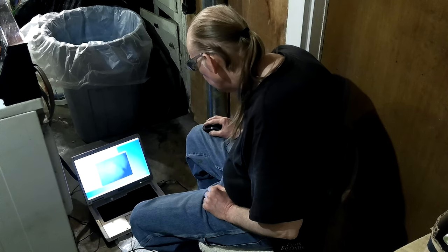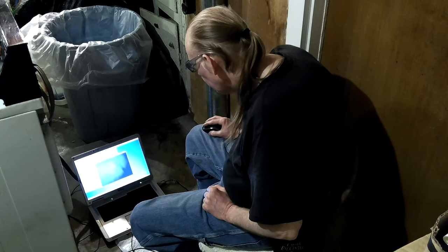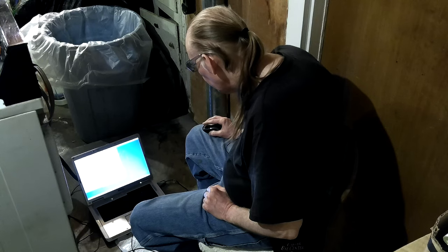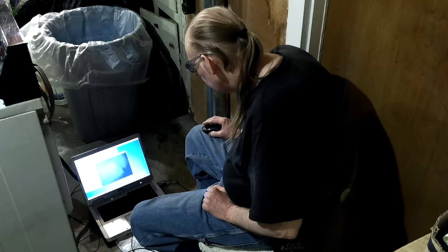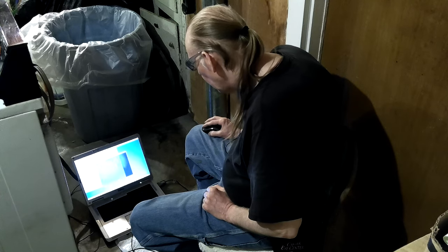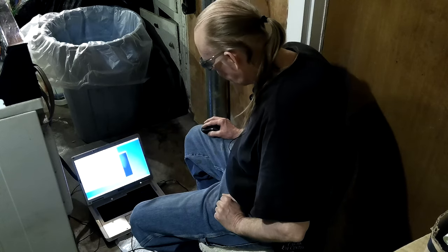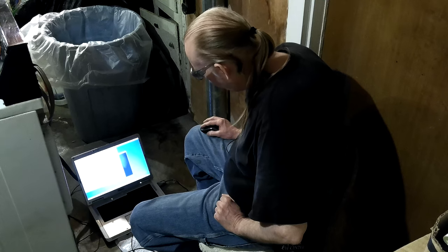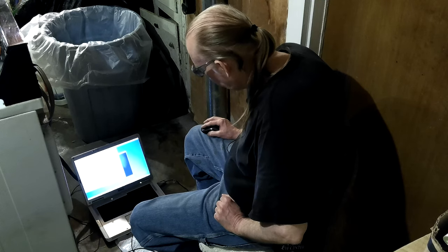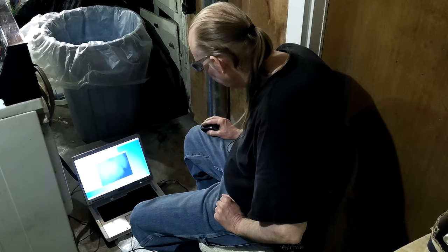Sometimes if your webcam is not working, you know it should work because it worked on other apps - look in these camera output settings. This is YU12, and then there's YV12. They're all looking the same. This camera on different apps, using the USB, will not work at all unless you pick the right format - sometimes YU12 is the only one that will work. Did I try RGB? RGB is usually a little more fuzzy looking.